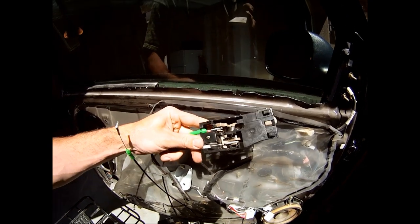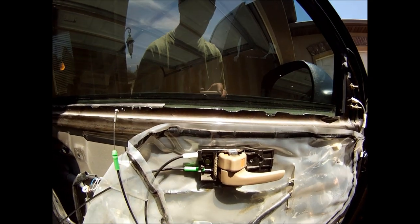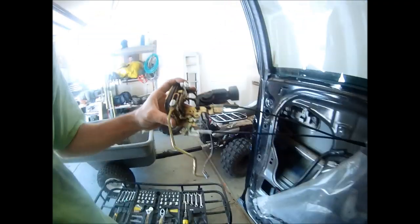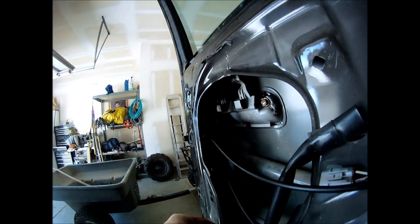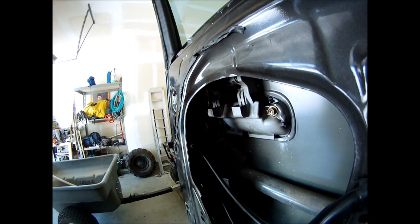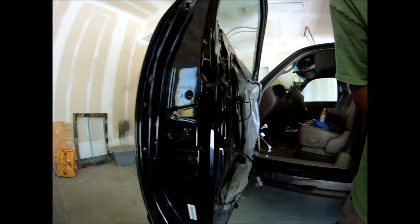That's the new one — just put that back in. You can see how that goes in, and I ran the wires through the plastic door panel and reinstalled the 10mm bolt. So this is the bad one still in — I'm going to pop that off and put the new one in, and you can see that's where the little toggle goes. This is what it looks like with the new one installed. You can see how it all connects and as we pull the handle it activates the lever. Problem solved — now we just need to install the last few parts. I've inserted the door unit and reattached the upper locking mechanism and the lower mechanism for the key. I'm going to attach the three bolts on the outside to hold it in place.